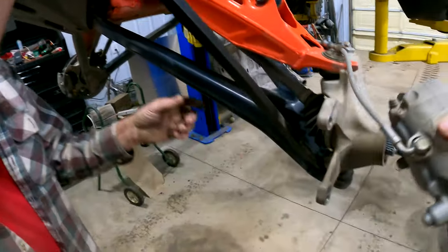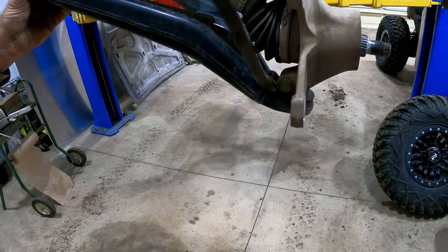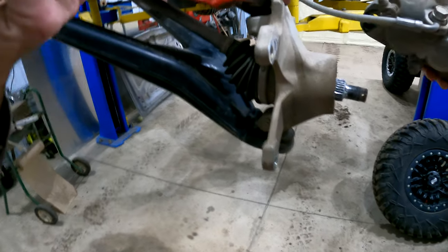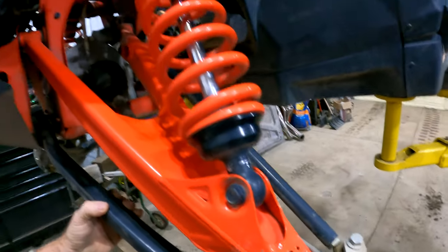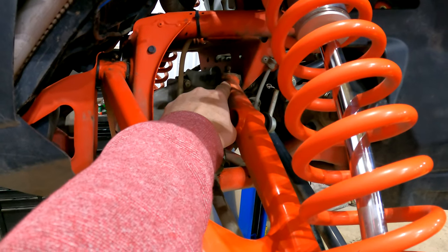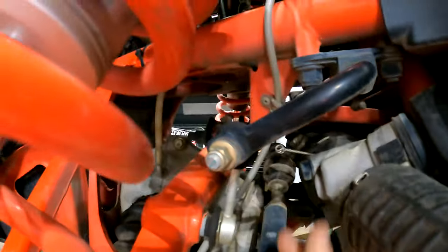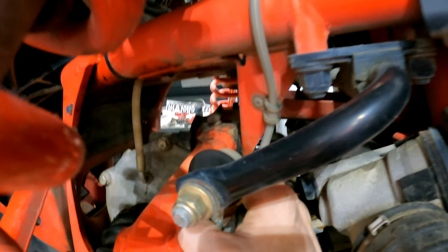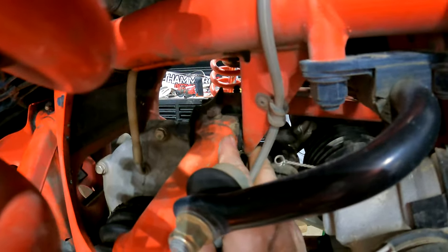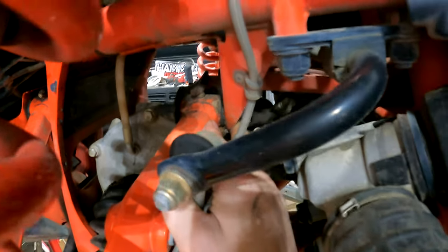You can't really grab them and test them — you just stick a bar in here. There's a little bit of play in there. Oh no, that's where it's coming from — see that, that's moving. I think that bolt's loose. Yeah, the bolt's moving — it's loose. There's another big clunk, so this has got to be tightened up.